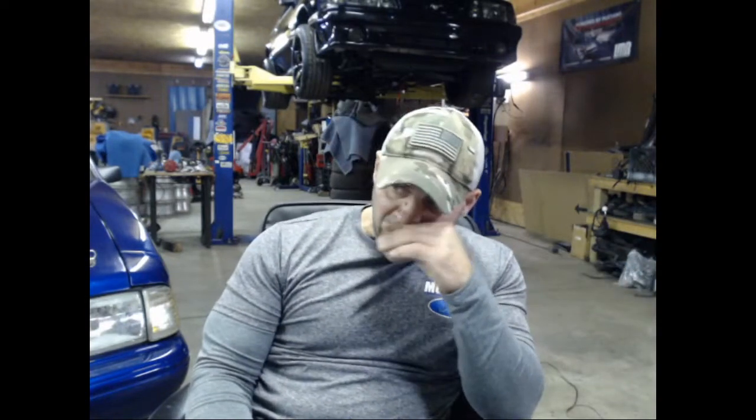Thinking about going 6-speed. I'm going to be honest with you, there is no budget and T56 shouldn't even be in the same sentence. However, if you're going to do a budget-minded T56 build, I would assume on a small block Ford motor, aka 302, 351, you're going to have to spend the money on the bell housing and the cross member and the drive shaft.